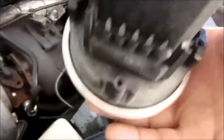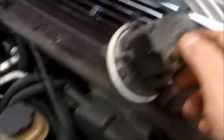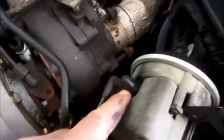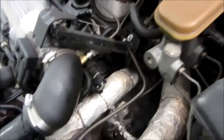She's back on the car. I've got the vacuum supply connected, the secondary release port capped off, the electrical plug in, and the throttle cable clip on. You can move it by hand and the throttle's working. Looks like it's ready for a test drive.